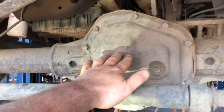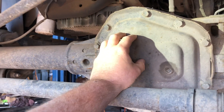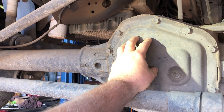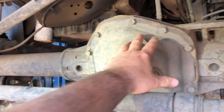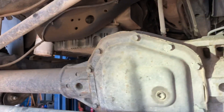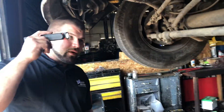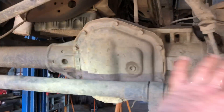The big deal here is when people are doing this solid front axle — if they ask for a front differential, which you might be thinking 440, Hollander part number 440 — most people find it's so much work to swap these gears out, and there's a lot of specialty equipment needed. So most people will just go with the entire 434. That's how we sell it, because it's easier to replace this whole unit than it would be to pull these gears out. There's a weird exception to this rule: Toyotas and Nissan trucks have what they call a dropout 440 with a solid axle. That's unusual, but it does happen. The Ford 9-inch is like that as well — the Ford 9-inch also has the dropout where the bolts are not going to be on the front but on the back. So this is a solid front axle — this is a 434. With that, let's cruise over and look at another design.